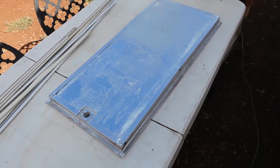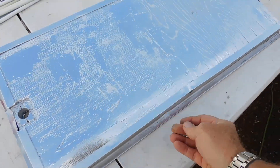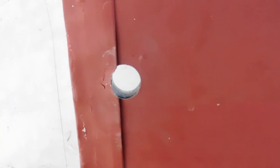I really thought this door was completely rotted out because it was so spongy in the middle, until I took it apart and realized it's Luan with a one-by-one framing — so these doors are hollow, which would make sense why they're so light. I drilled out the old locks, got new ones ordered, filled some holes with JB Weld, and using three-quarter inch coarse thread sheetrock screws, I replaced some of these nails.